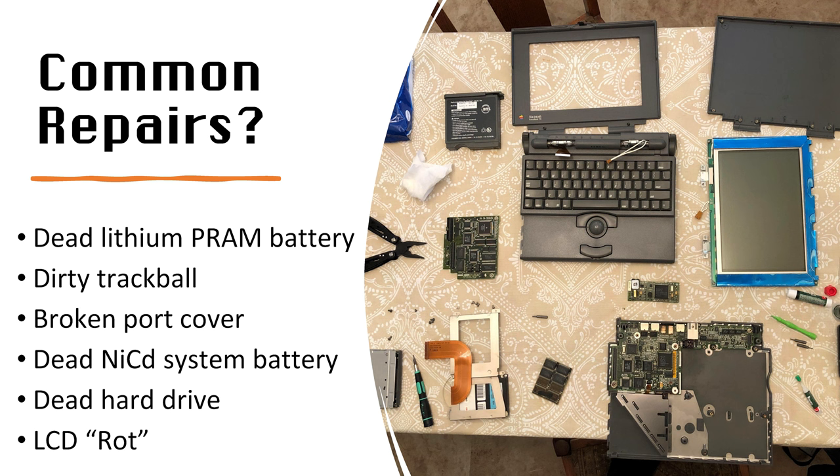All the drives are dead. If they're still alive, it's because it's dying right now — it's luring you into a false sense of security. You put it all loaded up, ready to go, you're going to take it somewhere and show it off — the second you close the plastic, that's it. Thankfully there are replacement products like the Blue SCSI — they have a PowerBook edition that's great. It fits right in there and saves you on battery power and spin-up time. And there's LCD rot — your screen. This one was a donation, it's very nice, but there are some pressure points. You'll see it's a little pink. We're going to give a link at the end of the presentation with examples of how these things degrade.